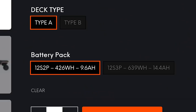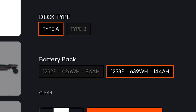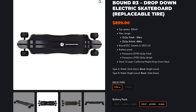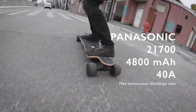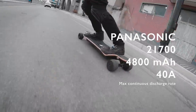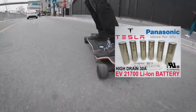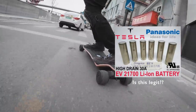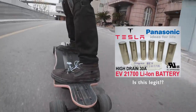Bound Motor sells this board with two battery options: one is a 12S2P with 426Wh, and the other is a 12S3P with 639Wh. They use the same battery cells and the difference is only $100, so I'm not sure why they even offer the cheaper option — definitely get the 12S3P. The batteries use Panasonic 21700 4800mAh cells with a discharge rate of around 30 amps. The exact model number is unknown, but those specs look pretty good. If you know more about these specific cells, please leave a comment.